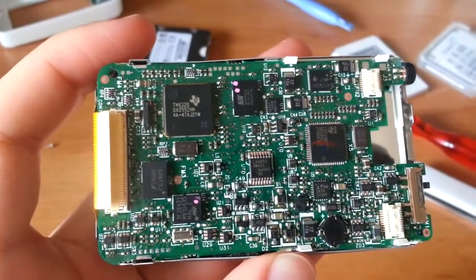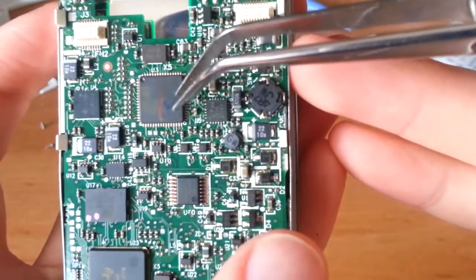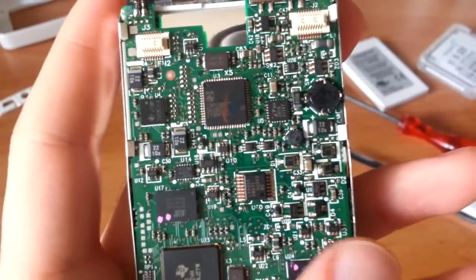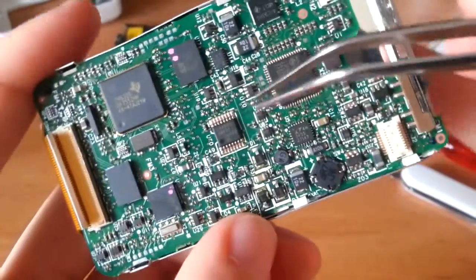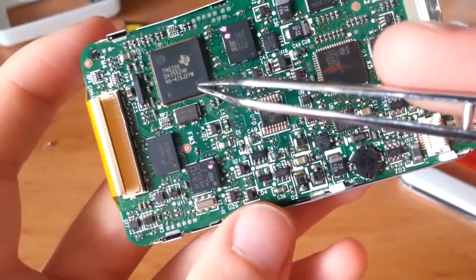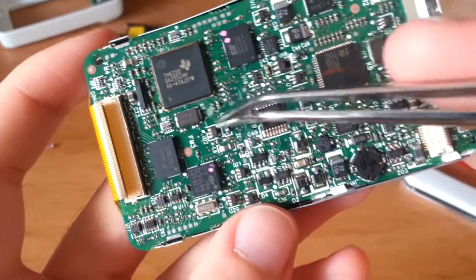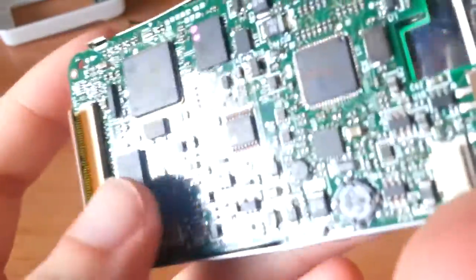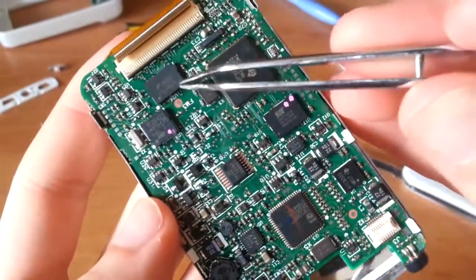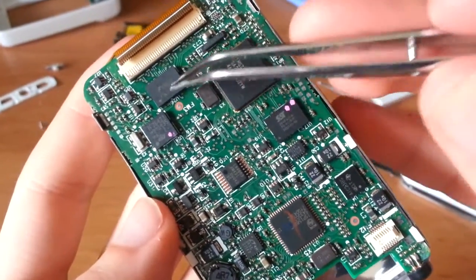There we go. You'll notice a Texas Instruments TMS320 here, a Philips ISP1580, and someone drew with a marker on it to show that it passed regulation. And let's see what else. I see ST parts, SST. This appears to be the main processor. You'll notice the tuning clock here. Probably it's the main system clock. Oh no, this guy's the main system clock. This guy's for the real-time clock. The main system clock is operating at 12 megahertz. And there's a Fairchild chip in here. Because it's paired closely to the hard drive, it looks like maybe a memory controller, like a hard drive controller of some sort.